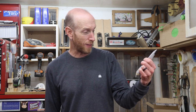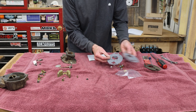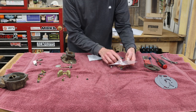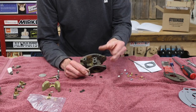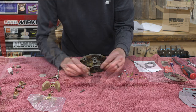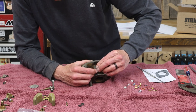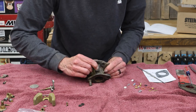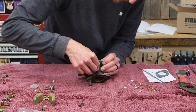So let's grab our kit and put this Marvel Schebler carburetor back together and see if we can get this thing running before the day's out. This kit is a lot simpler than the Holley carburetor rebuild — way less pieces. Looks like this kit covers a couple of different models, so we'll have to compare and make sure we get the right gasket. I'm going to start by installing the rubber seals for the throttle plate. These little rubber seals are kind of a cup shape. The way they were installed was the inner one with the cup facing up and the outer cup facing down. I've seen these installed several different ways and I'm not 100% sure which is correct. I've seen them installed with felt packing, which this kit includes, but this carburetor did have two rubber seals already in there, so I'm going to choose to put the rubber seals back in. There's not really any special trick — they just press into place. Just make sure if you use anything to press them in that you don't tear the seal.